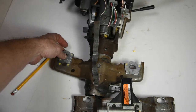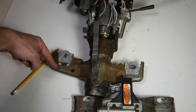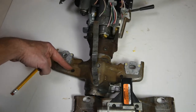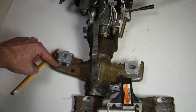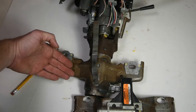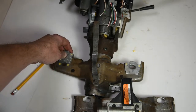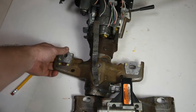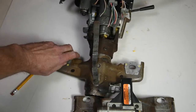These pieces that were bolted to the frame under the dash would stay bolted to the dash. As you can see, these aluminum pieces really weren't holding the metal steering column real tight. They were actually just holding with some injection-molded plastic which would break free pretty easy and allow the steering column to slide down in the dash toward the floorboard, so the driver wasn't hurt. These aluminum pieces would actually stay in the dash and not hurt the driver.